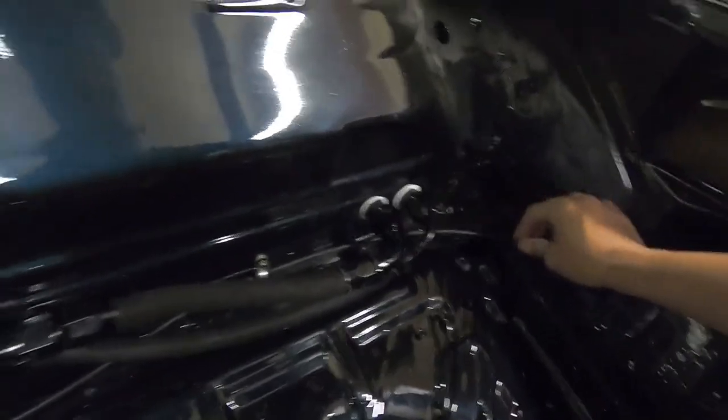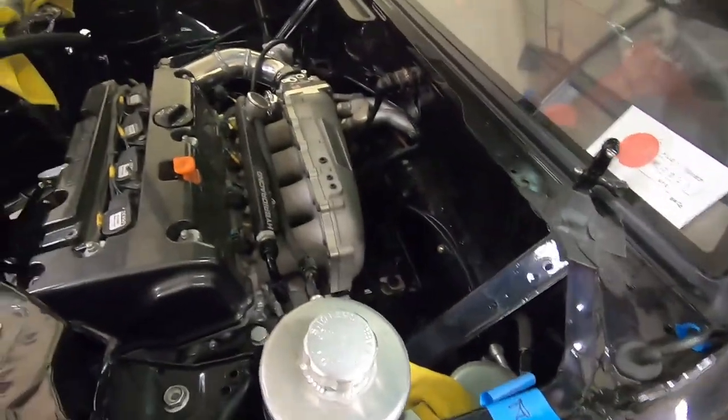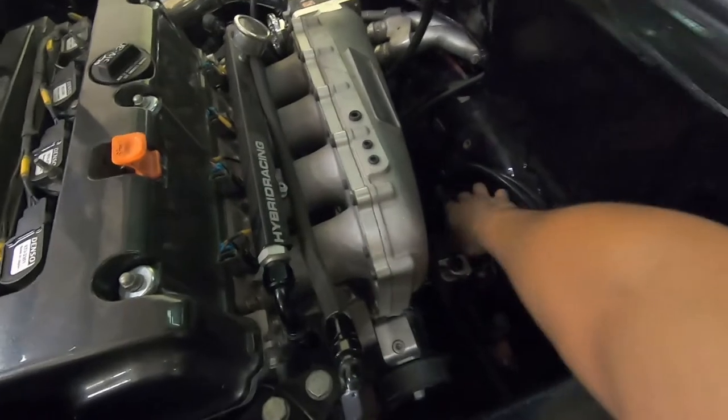Ran the power through the trunk. Over here I changed the carbon plate that the fuel pressure regulator and the boost solenoid goes on — four-port boost solenoid. I think that's pretty much it on this end. I had to relocate some of the wiring for the oxygen sensors, but nothing too wild — fairly straightforward there.